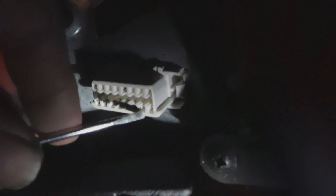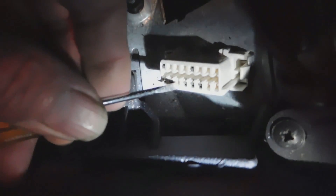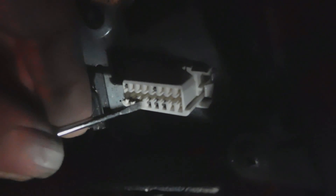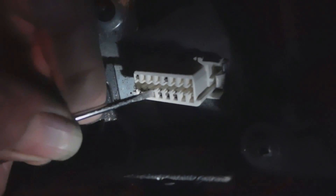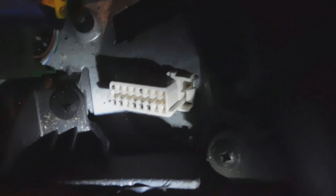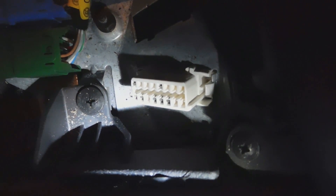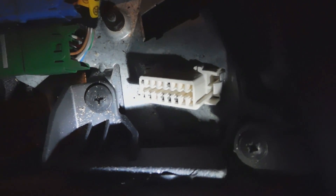You can see pins 1, 2, 3, 4, 5 — and pin 6 is missing, there is no pin 6. To bridge it for the codes you've got to bridge between pin 5 and pin 6. On this car, a 2001 JS series Vectra V6, if there's no pin 6 you're screwed — you can't read the codes, you've got to get a proper scan tool code reader.